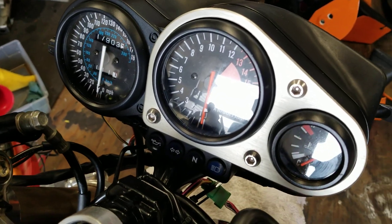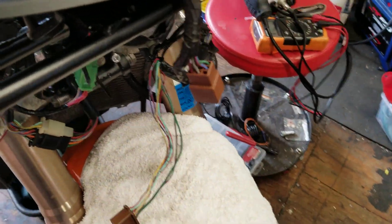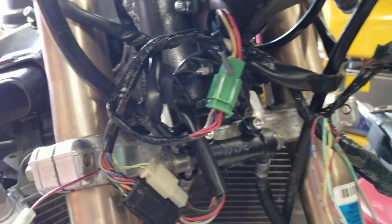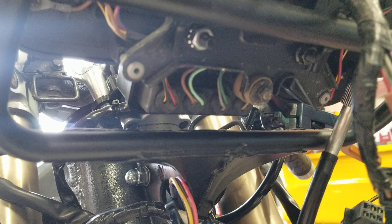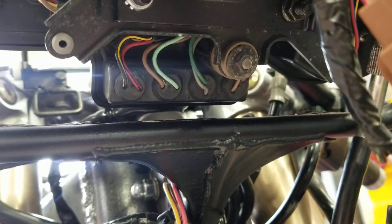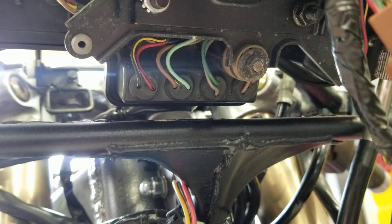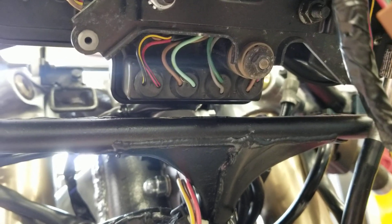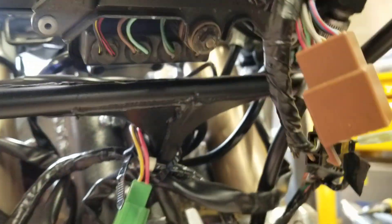What we're going to do is separate those sides. At the back of the light bulbs, the second light is the turn signal, and that is the green and gray wire coming up. We're not going to cut it there because that'll just be too short, so we're going to follow that back through the harness.